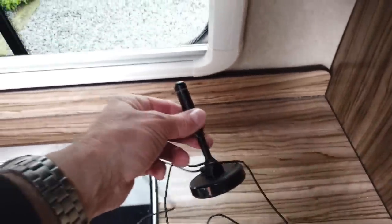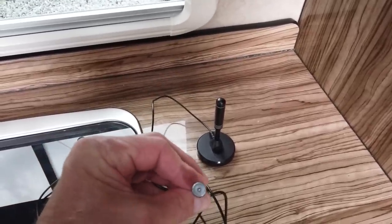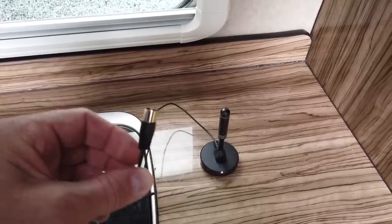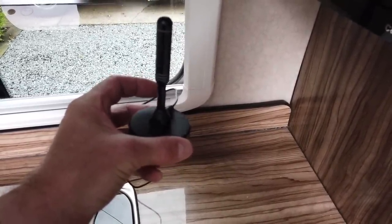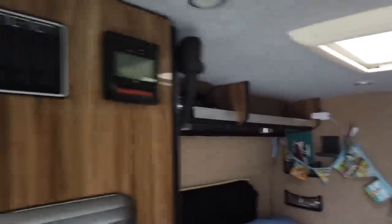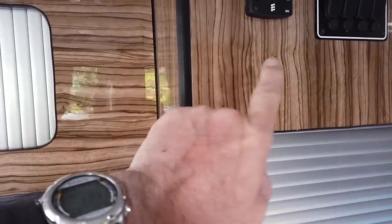I've purchased one of these car aerials off Amazon — I think it was about 10 or 11 pound. I'll put the link below. It comes with a standard coaxial male plug on the end and my plan is to put this on a bracket on the roof. It is magnetic but I'm going to Sikaflex it to the bracket on the side of the van, on the opposite side to where my wi-fi aerial is, and run the cables through the back into the top of this cupboard, where the original aerial goes through to an aerial booster and then out to both TVs.